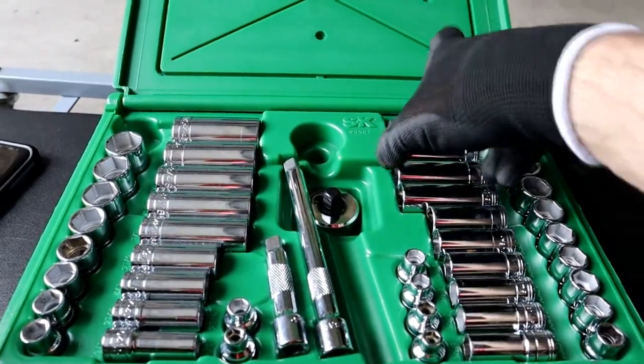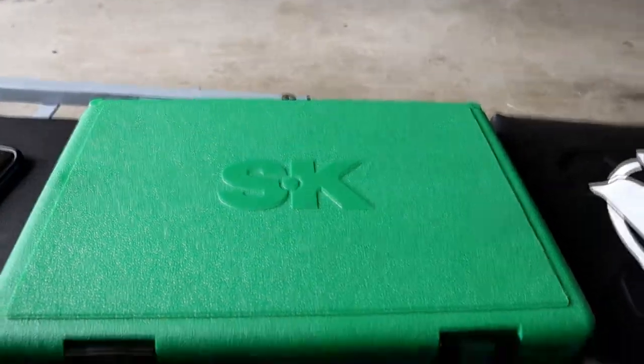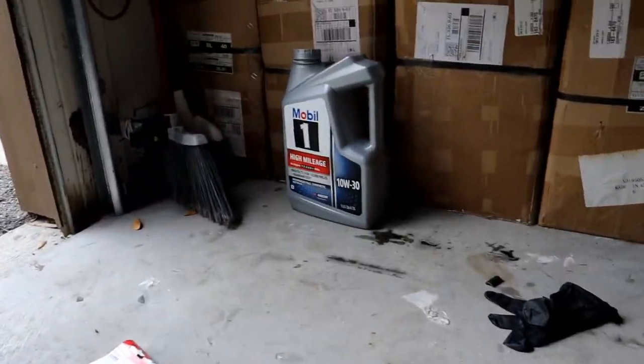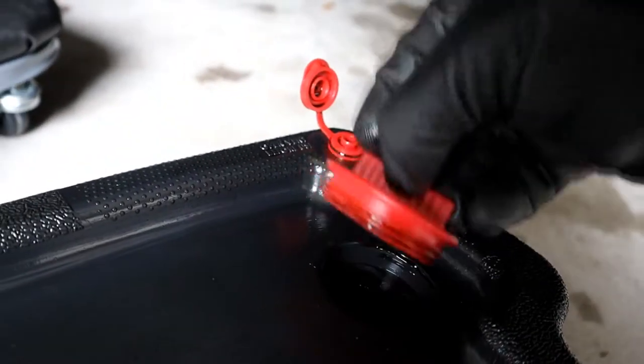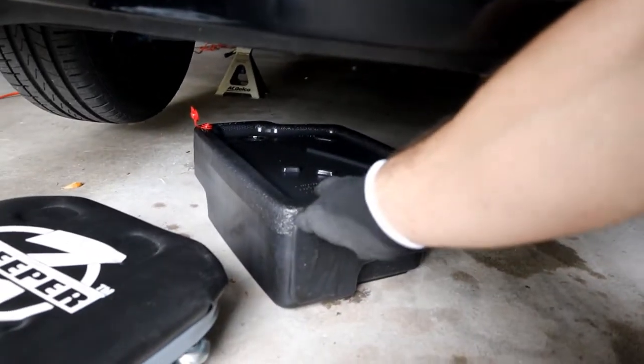This is one of my favorite kits ever — I'll leave it in the description below if you want one. You've got to grab one of these oil pans, otherwise your oil is just gonna leak all over the floor. Go ahead and take the cap off and leave the oil filler open so it doesn't start bubbling all over the place. Then place the pan underneath the car where the oil is gonna go.